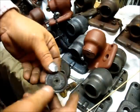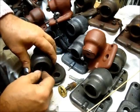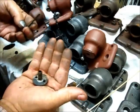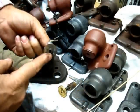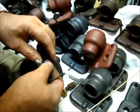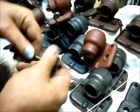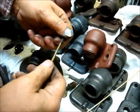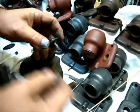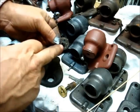The inside of this is not rusted, but it's gummed up quite badly. Let's get this out of there. It is the newer type with the two holes. And there's that washer that fell out — it had a washer in there for some reason; that's not original. And you can see, without breaking out the micrometer, that hole in one side of this compensating valve is worn almost paper thin on one side, looking at it.